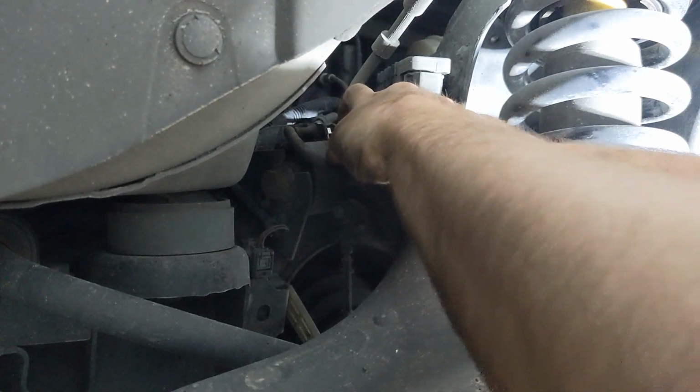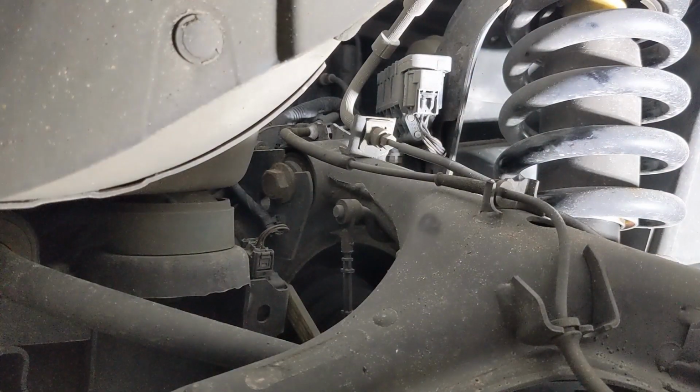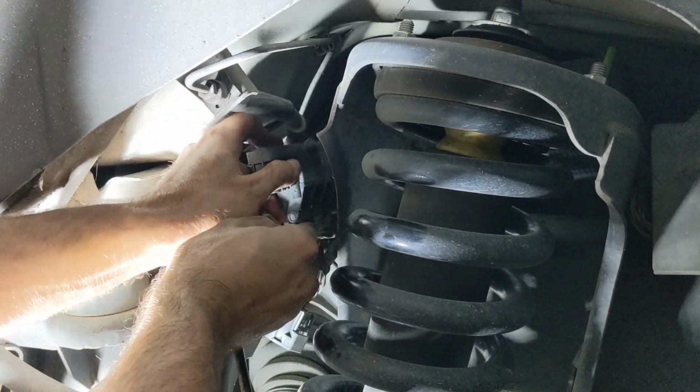This valve block is trickier than the other two to remove due to the lack of space. I would first pull the valve block away from the suspension turret by pulling it forward off of its rubber pegs. After it's a little more loose, take a small 12mm wrench and start removing the 3 air lines.